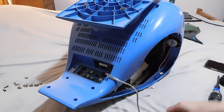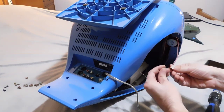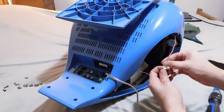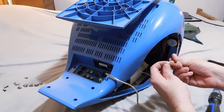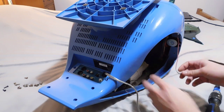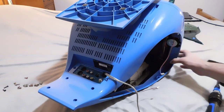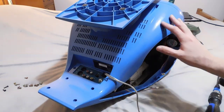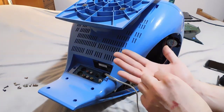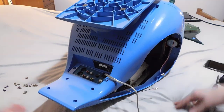All right, so I've made just a little bit more progress. What I wanted to do first was get these side panels off, and they have two little connectors on each side. Thankfully, they're different from each other. One has three pins and one has two pins, so it's impossible to mix up these wires. That was simple, just a matter of pulling them out. From there, I found that there were three more Phillips screws on each side that attach the back half of the chassis to the front half. Thankfully, just like everywhere else, they're the same types of screws, so you don't have to worry about keeping them separate from each other. So now that I've done that, you can technically move the...